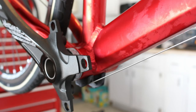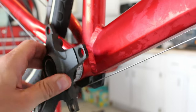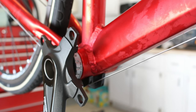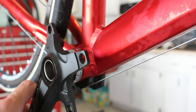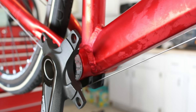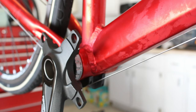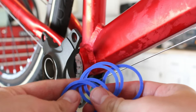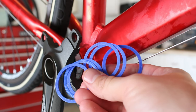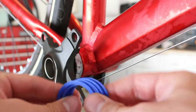I have to be honest — it looks like I made a mistake because this crank shaft is quite a bit too long for this bottom bracket shell. This is a 68mm bottom bracket shell, and it looks like this shaft is more suited for the 73mm. Normally it does say 68 or 73, so the solution is to put a bunch of spacers in. But because I didn't get the bottom bracket with this kit — and by the way, that was my fault; I looked up the order and I ordered the wrong one — I don't have the spacers either.